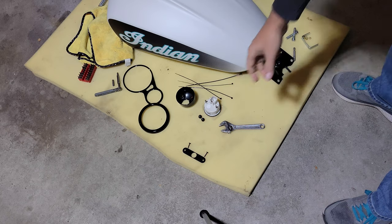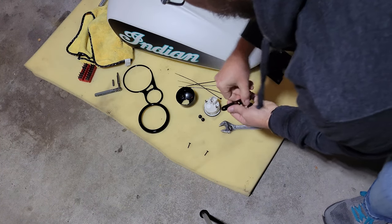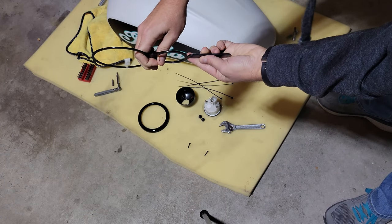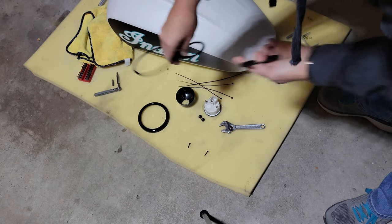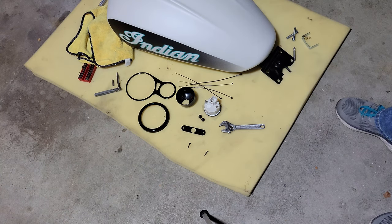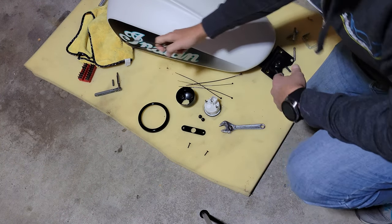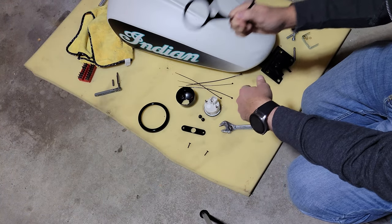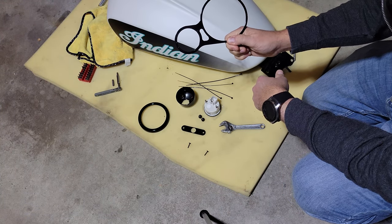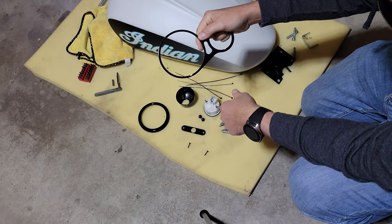This actually goes underneath the speedometer to lift it up the same thickness as the new tachometer ring that you're going to sit under there. So we are good to go, and we can now continue. The instructions do still try to tell you that you must mount this on the left, but I'm going to ignore that, and we're going to mount it on the right.